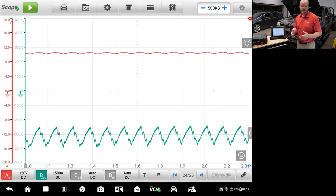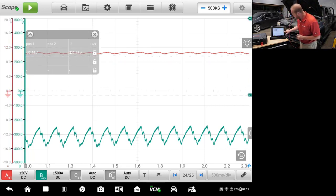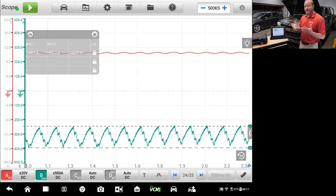Now I want to measure the amperage information from the green channel. I'll select the green channel from the left side of the screen and pull that tab down to give us the top and bottom measurements. By doing that, it gives me a reference line to see whether all of my amperage peaks are pretty much the same across all the different cylinders. If I want to break it down and view only an eight-cylinder window, we can do that as well.